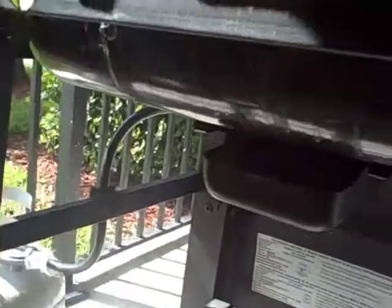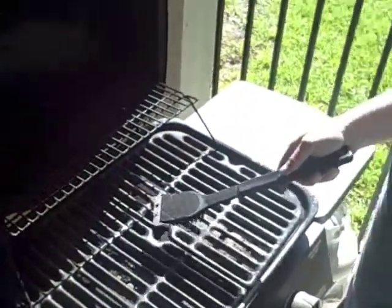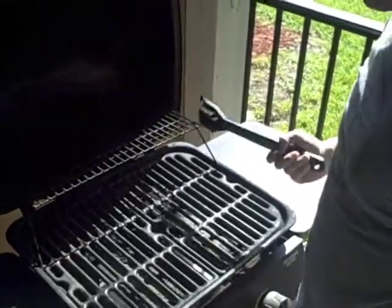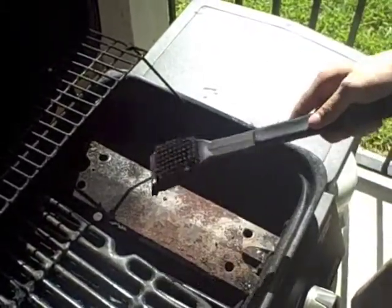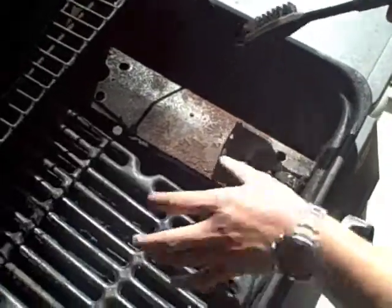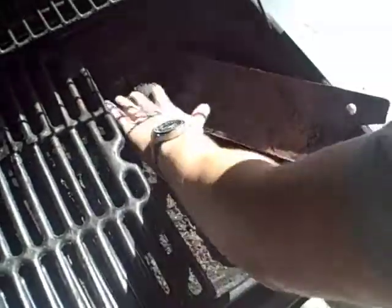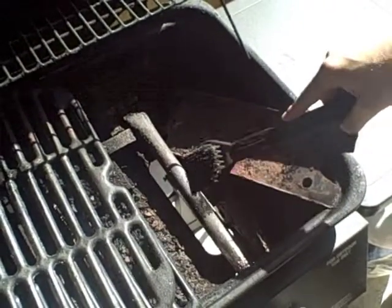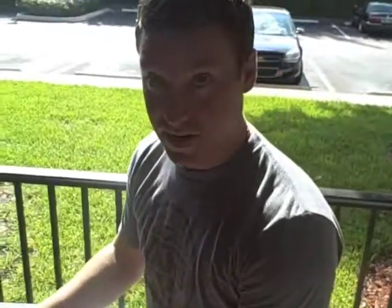Another thing you want to check is the inside of the grill itself. Looks like my neighbor here keeps his grill moderately clean. You want to make sure your grill is always cleaned up on the top before you start cooking. Down here it's got a lot of charred food buildup — you want to make sure you stay on top of it. The burners right here — you want to make sure the holes are clog-free, because having those clogged will cause propane to build up, and once it builds up it could push out the clog and create a rush of propane, which can cause an explosion or small explosion.